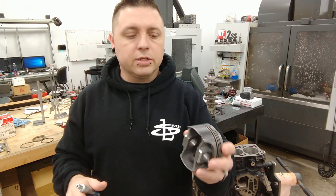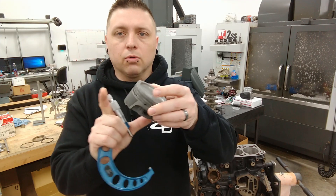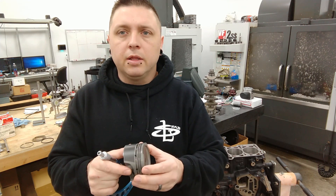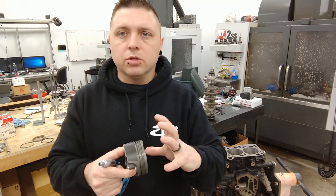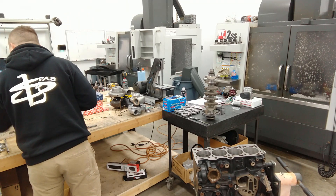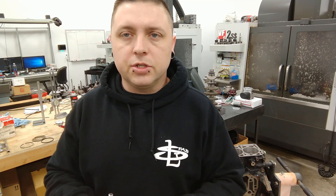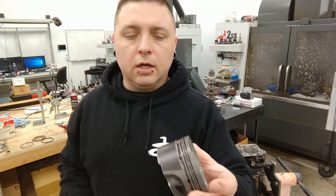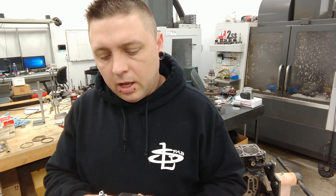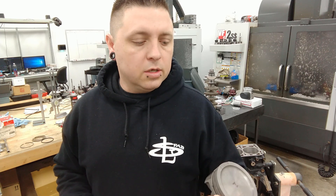As far as the tolerance goes, it really depends on your pistons. These, like I said in an earlier video, are low expansion pistons so they don't grow as much with heat as a true racing piston. They're a little bit different alloy — it's a stronger alloy but it grows more, so you have to have more piston to cylinder wall clearance. These recommended one thousandth to one and eight tenths, basically just under two thousandths. I chose to go a little loose just because I knew I'd be throwing some boost and heat at this motor, and I'd rather have it rattle a little bit when it's cold than grow too much and lock itself into the bore or score up the cylinder walls or the piston skirts.